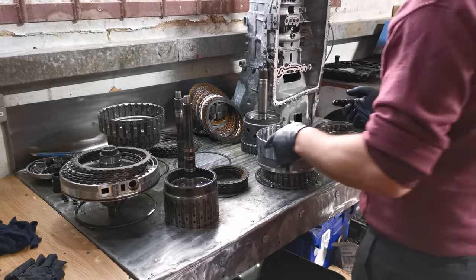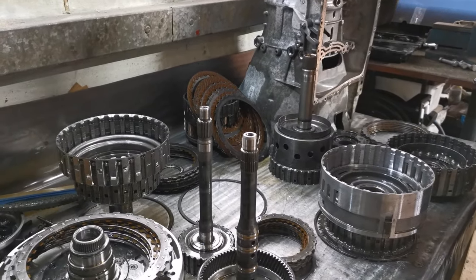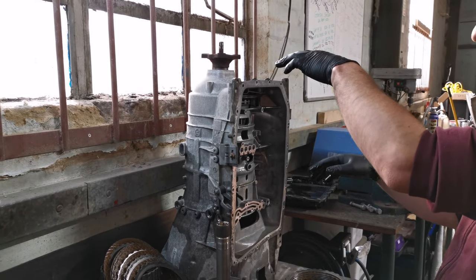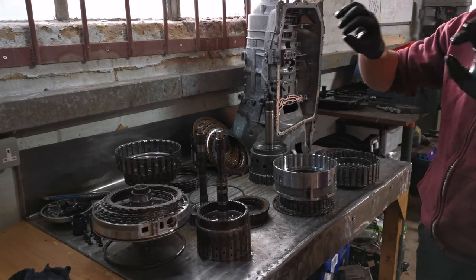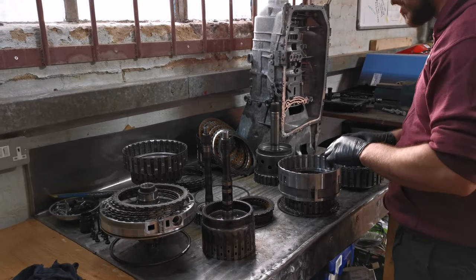One thing that I won't be showing in the video is the E-clutch output. At the very end of it will actually slot into the output flange on the box. There's a bushing in the back of there, I've still got to remove all that. But that bushing's also got some excessive wear, just also allowing the E-clutch output to float around and just not holding the whole E-clutch assembly as it should be. So I just thought I'd point that out as well.